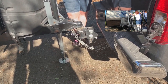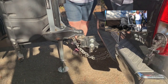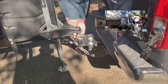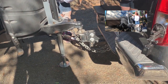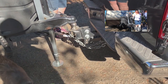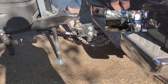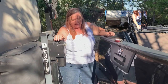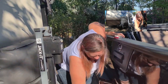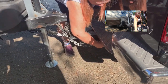We made sure that we put the wheel chocks in, right? Now we can take the safety chains off. I don't do it before because just in case those wheel chocks didn't work out or we're on too much of a hill, the chains are a good safety feature so that the trailer doesn't roll. So go ahead and release your chains.